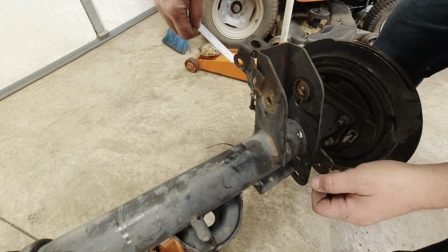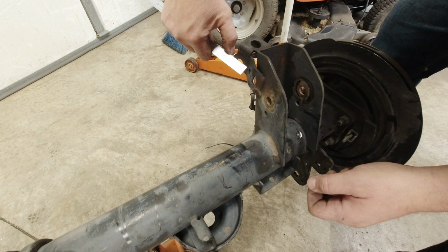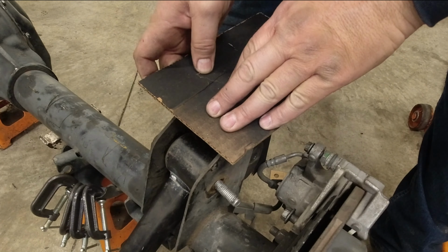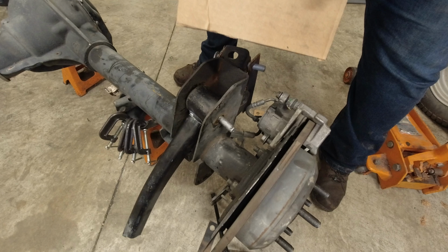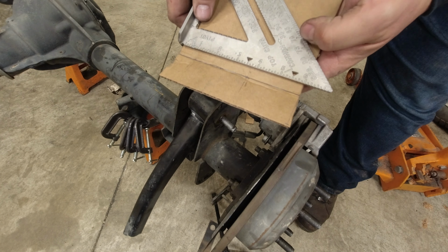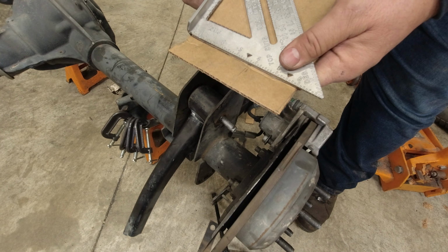All right, to get this template started, I'm gonna need some strips. So some 1.5-inch strips here. Probably be about the same here. So let me put a bend in this. A good way to bend this stuff is just use your speed square again. Kind of put it where you want it and just fold it in.